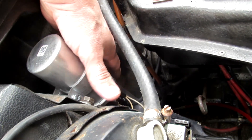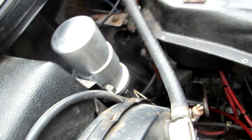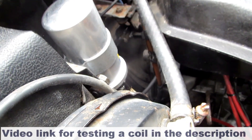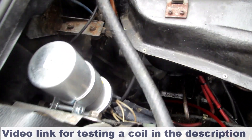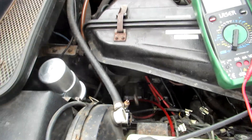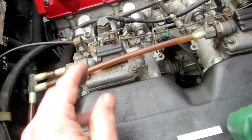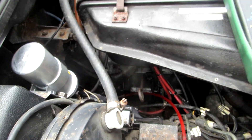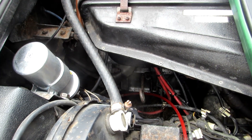You ground the negative directly to the engine, or use a dangling wire. You hold the HT lead near the engine, not quite touching it, then dab away with the negative connection. That simulates the contact points sitting on the rotor at the distributor cap. It produces sparks against the engine and a higher voltage spark at the end of the plug, so I quickly established that the coil was working as well.